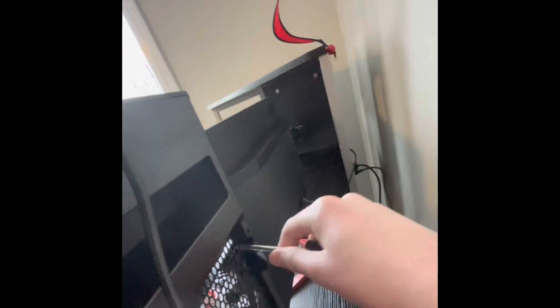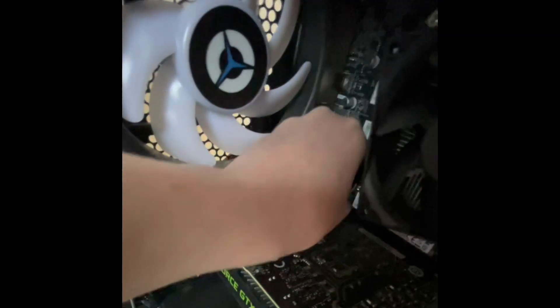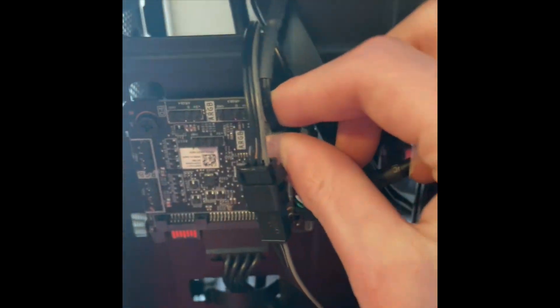So the back one is where it gets a little weirder. What you're going to want to do is push your PC maybe a little more forward so you can actually get some better access to it. It's basically the same deal. There are four screws — one, two, three, four. I'm going to unscrew that. This fan right here connects right there above the GPU. I'm just going to pull that connector out. And there you go — this fan is now loose. The connector is also braided. I'm going to have it rest on the GPU. And there goes the fan.